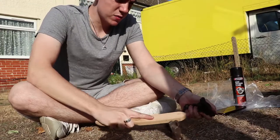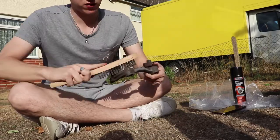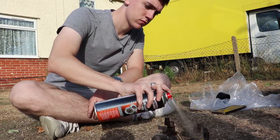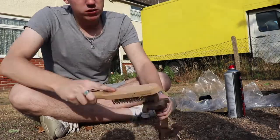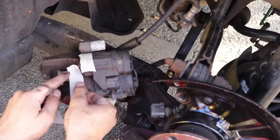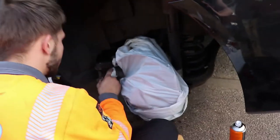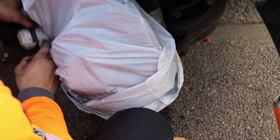The first thing to do once you have your caliper taken apart is to prep the surface by cleaning it. Your caliper will have accumulated a lot of brake dust over time and it's pivotal to get rid of all of that before doing any layers of paint. Using some brake cleaner and a wire brush, we kept filing away at the caliper until we could see the natural color shining through. It doesn't have to be perfect but you want it as clean as possible, alternating between the brake cleaner and the wire brush. While I was prepping the caliper, Liam was using masking tape to mask up parts of the car that couldn't get paint on — other car parts, screws, and rubber caps — to prevent overspray. He then covered the area with a bin bag to further protect surrounding parts.